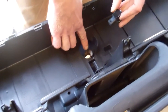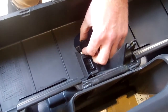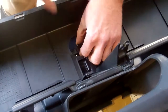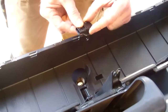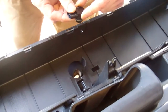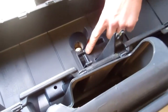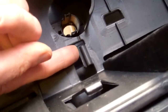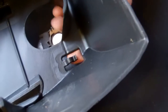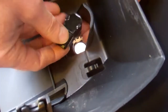So that's how the parking sensors fit, but you can't actually fit it now because you've got to dive that under there and connect it, and it's going to be impossible to get the connector in. So you'll have to fit these onto the parking sensor loom and then put them in with the wiring. And also to note while we're at this stage, there's a little route where you bring the parking sensor cable in behind there so that it guides it neatly, and likewise here on the end you've got this little clip, so you can tuck the wire in behind here neatly, and then you need to bring that in.